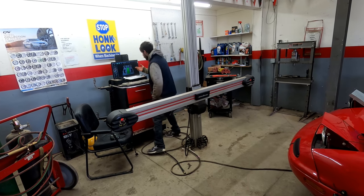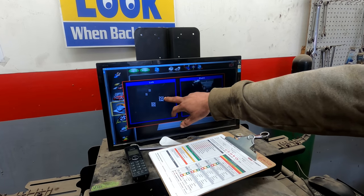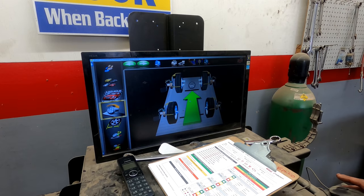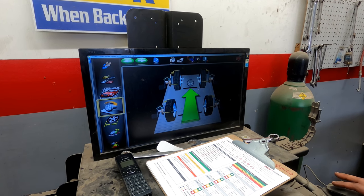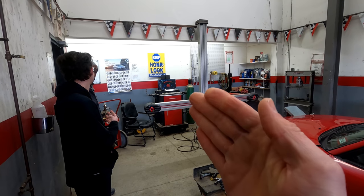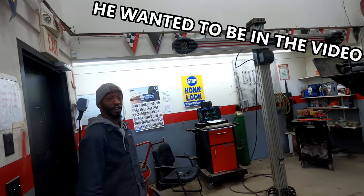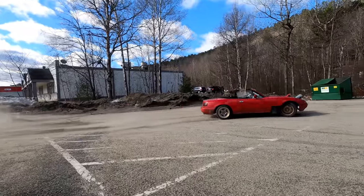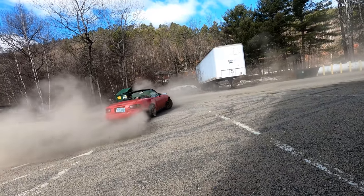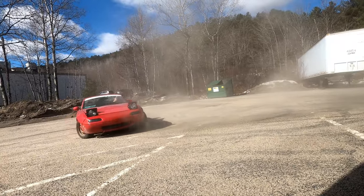So if you want to go over here, it's probably easier to show on the screen itself. When you do the actual alignment, those little reflective markers actually measure which way the tire is tipped — so if you have a camber issue, it'll tell you that; if it's got a caster issue, it'll tell you; toe, all that. It also measures front and rear. When he's moving the tires, that screen will also move. It's kind of cool. Alright boys, meet Frank. How's it going?